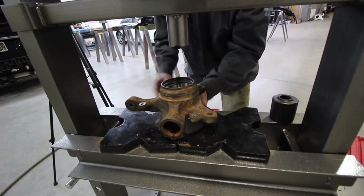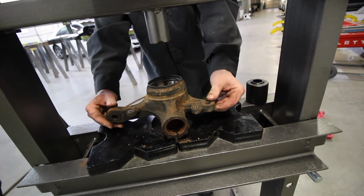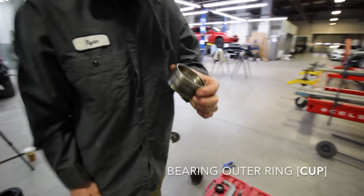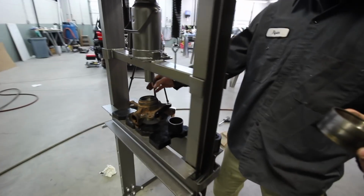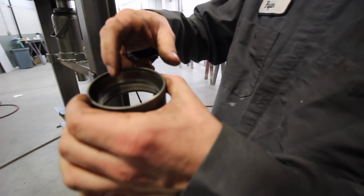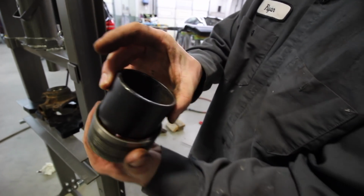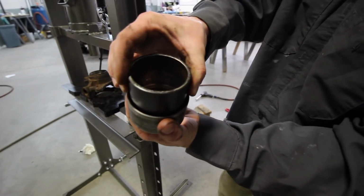This is fine. That should be fine. Once you get the pressure in there, it'll support itself. There we go. So this is an old bearing, one that I've already done, and you can't get around to this edge because there's a lip in there that doesn't allow you to get to it. Okay. But it's hard to see, but it is narrower in the middle. All right, yeah. So funnels in. This one here will go around the outside, but it'll get stuck on that narrower middle section. That makes sense. So this is what I'm going to use to press this out. Okay.